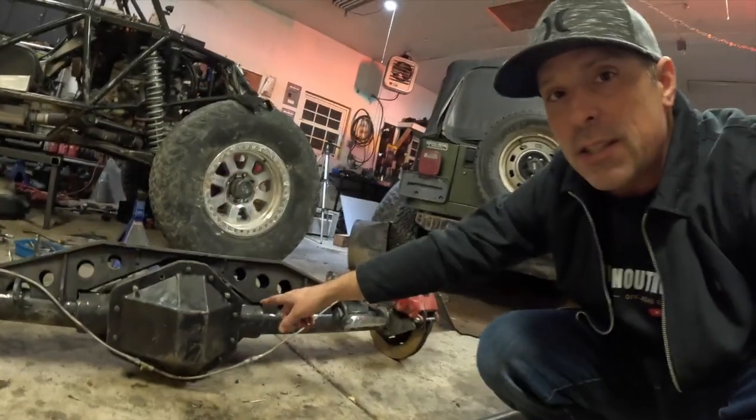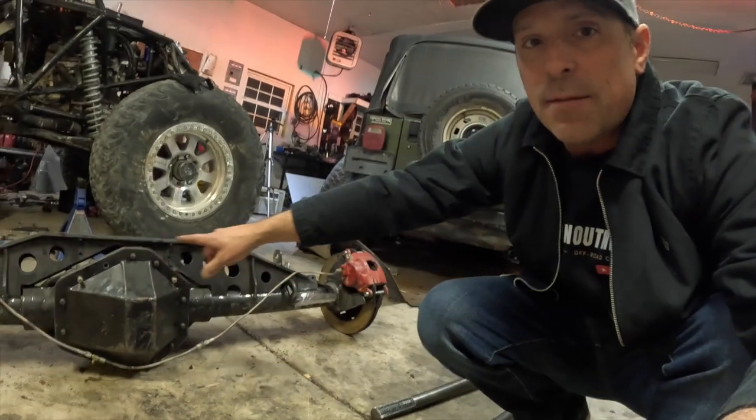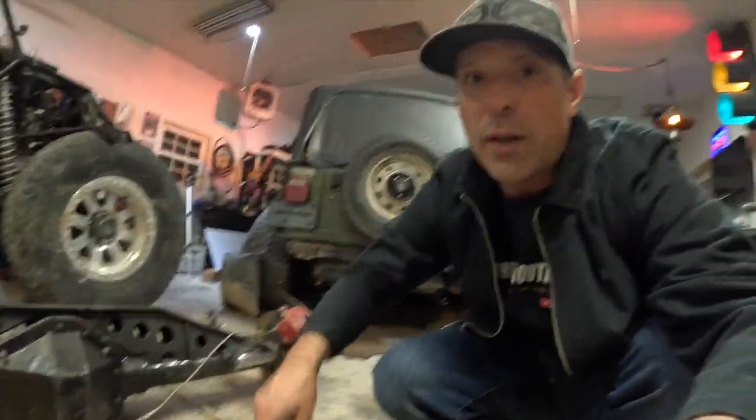I'm just going to start fresh with this housing. This axle housing I got from my friend Gabe Wellfelt — it's got a very nice truss on it that goes all the way to the end. The only reason my old one didn't go all the way to the end is because I cut it down for clearance, making it a little shorter. I didn't think it would matter much since other axle trusses on the market don't go all the way to the end, but in the long run it still ended up bending.